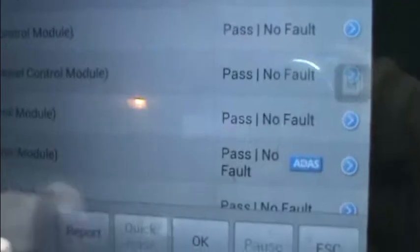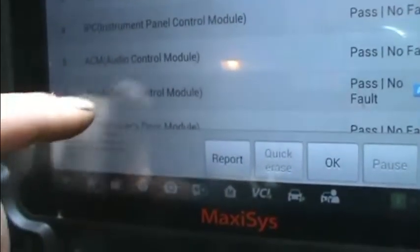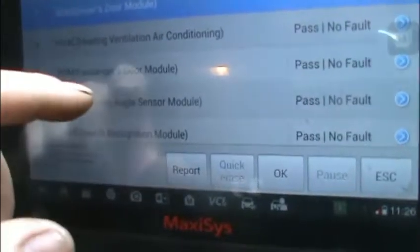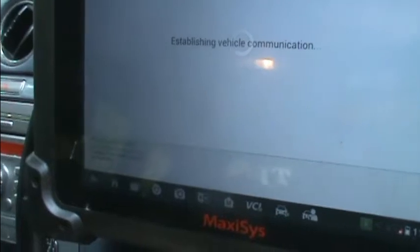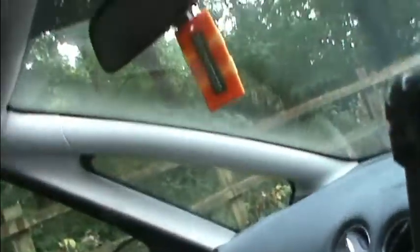Right, so let's have a little look at my scanner and see what we got. We've got no fault codes at all now. Nothing in the instrument panel. Obviously I would say that powertrain one's going to come back, but you remember the driver's door, that one there you couldn't even get up, but she's fine. Have a quick look in there, see what we got going on. Come on baby, read the codes, and as I say, I can talk to it now. And all I did was put 12 volts to it, because that's what the wire was that goes to that door. Oh, hold on, idiot here, put the key in the ignition, but it tells me I've got no codes. So these doors were fine, that door was fine, they locked, electric windows worked, everything.